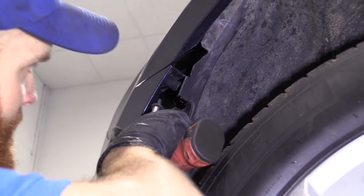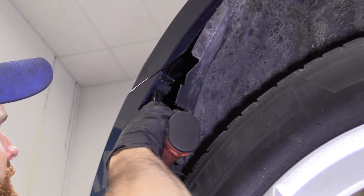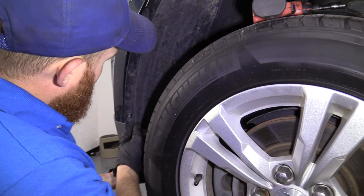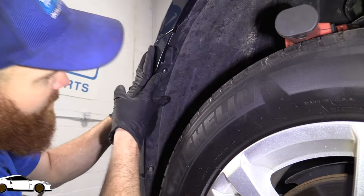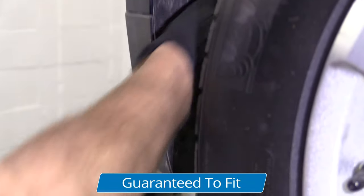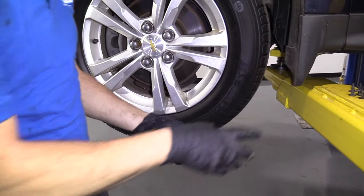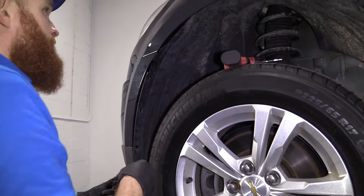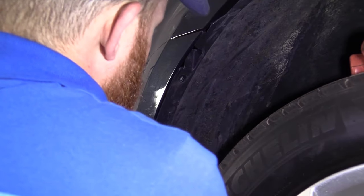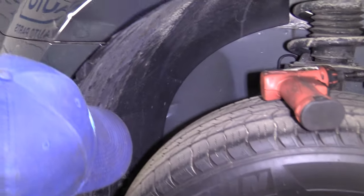We remember that we had the one seven millimeter head bolt that goes right up through here — it goes through the bottom of the bumper cover up into the fender. I'm just going to find the hole here. Nice and snug. So now when we look at it, you can see behind there there's a metal piece — that's where there's a screw. We've got two screws and four little push clips. Let's do the push clips first because they'll keep everything generally where it should be, and then we can worry about putting in all those screws after.